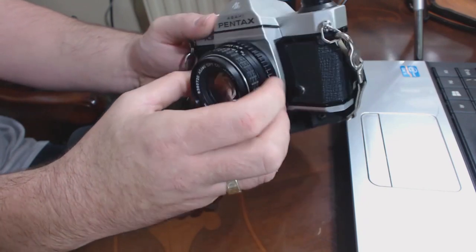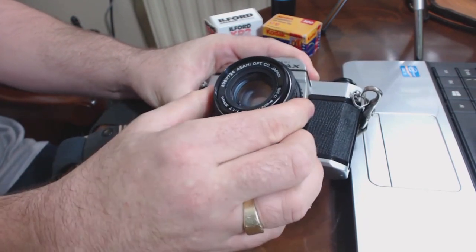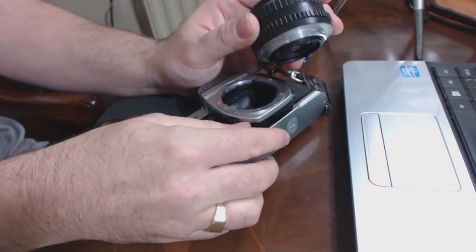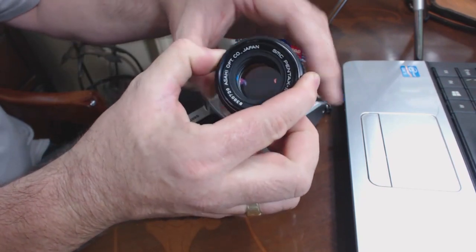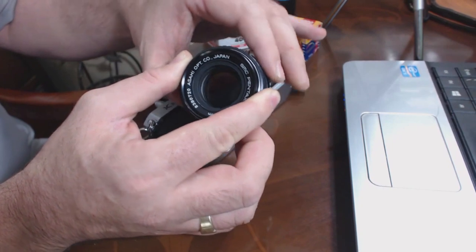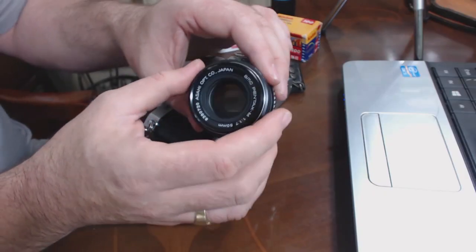Obviously if you're at a car boot sale or charity shop, ask if it's okay to do the following things. Slide the lens off — you press that little lever down there and turn the lens. Have a good look at the lens, and what you want to do is slide it in and out to see the aperture changing — making sure it goes all the way down to the smaller setting and all the way open. Quite often older cameras get sticky aperture blades because the lubricants after 20 or 30 years get a bit sticky and won't work. Also turn that focusing ring — does it move nice and smooth?